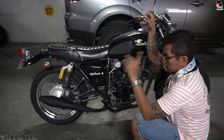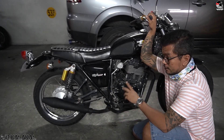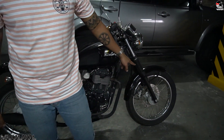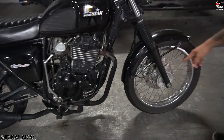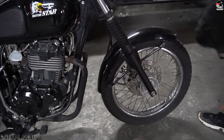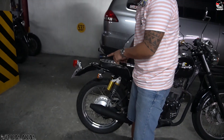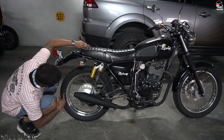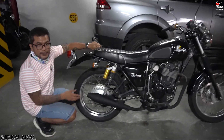Of course, the carb will be tuned — we'll have Jason tune the engine right away, because there's also backfire. And of course the pipe will be replaced with beer pipes — shoutout to Brian Champ. The tires still have good tread but we'll replace them. For those asking about Cafe 400 tire specs: rear is 18-inch, front is 19-inch. The stock setup uses Kenda 100/90-19 front and Kenda 130/70-18 rear.